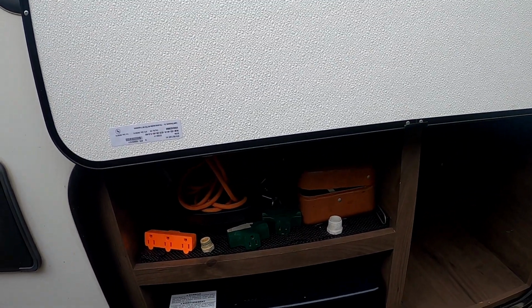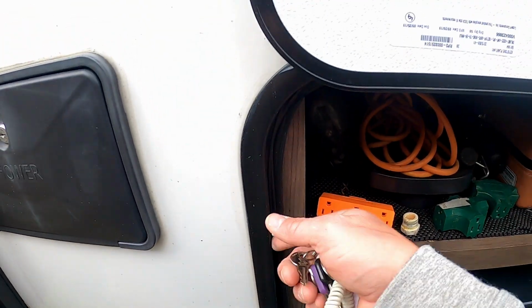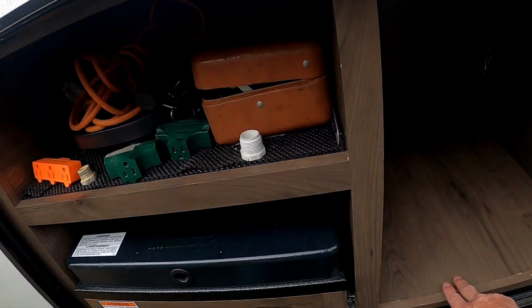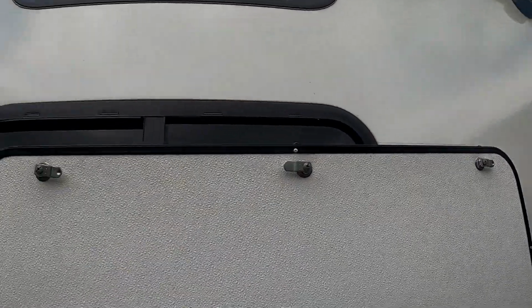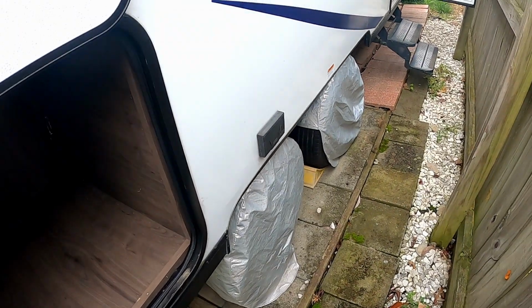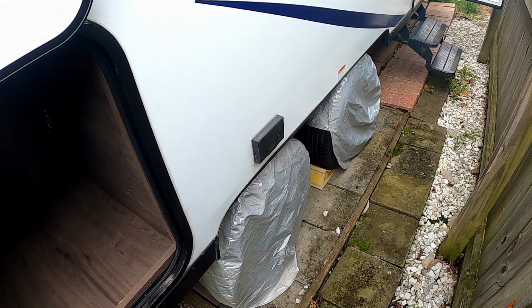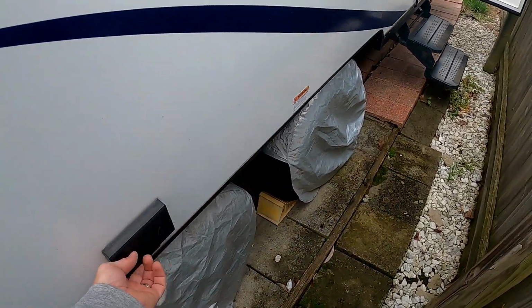So you want to check that out, and then check in here, check your seals once again, make sure they're not dry rotted. Feel around, make sure you ain't got no water coming in. Everything's looking good. So on this side, I'll check around these windows, make sure I don't have any cracks, and I'll check the integrity of the side of the camper, make sure nothing's going on. All right, with these tires, it's going to be the same checks that I did on the other side.